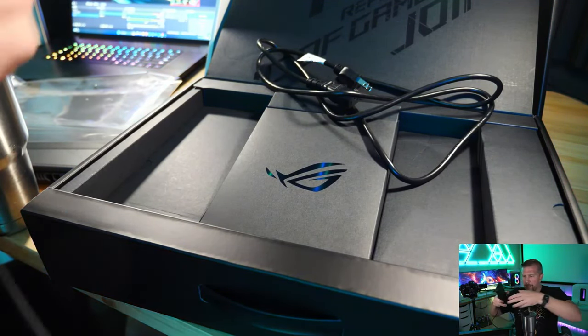So this is not necessarily designed to be a quiet laptop. It's designed to be a portable laptop. But you can go into quiet modes with reduced performance. But we're not testing the laptop that way today. We are testing the laptop with max fans to get the most performance we can possibly get. We have 100 watts of power still being pulled by the CPU, 90 right now, 94, but it was doing 100 just a second ago. We're averaging 97 watts for our entire duration of the test so far. That's very good. Our core temps on the CPU are 88 degrees though. CPU package is 94 degrees.